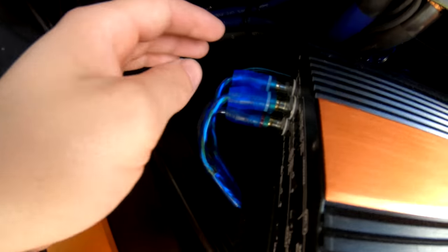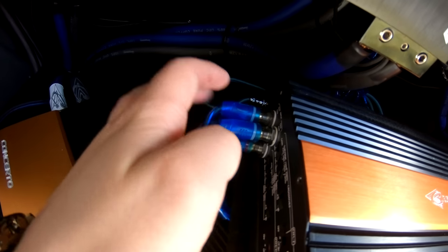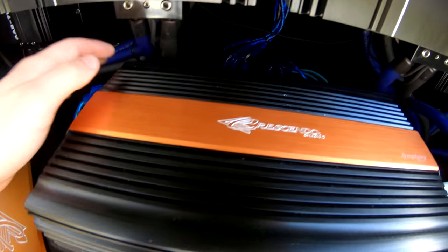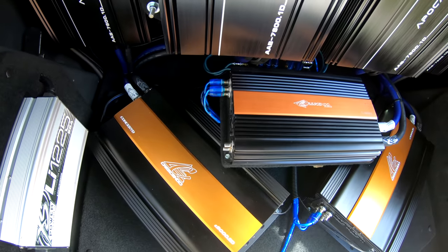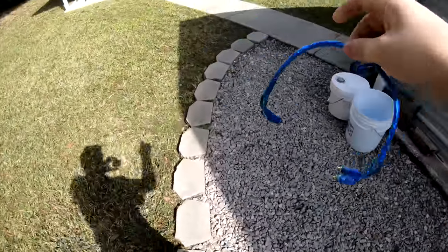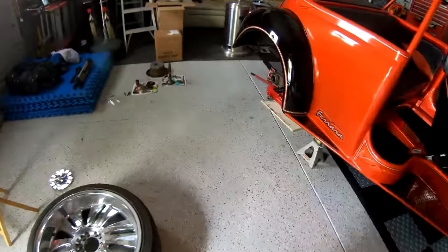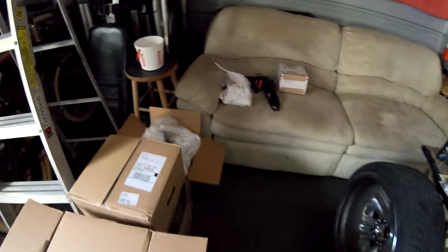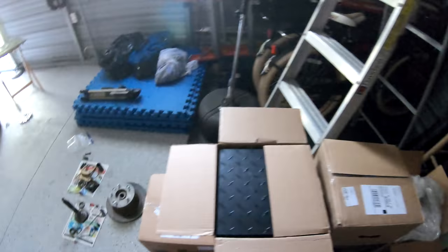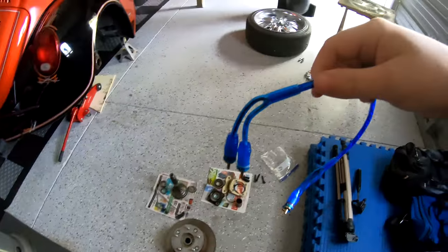It should be these two RCAs right here. This is my left channel and my tweeters. Not sure which one runs to what in here, but we'll find that out very quick and swap them out. Hopefully this is the culprit. Let me find the old ones — we got the truck here all torn apart. I think he's doing some wheel bearings. I'm going to try to find the old ones and stick them in.